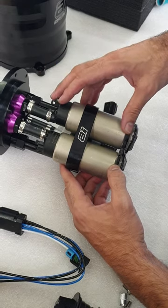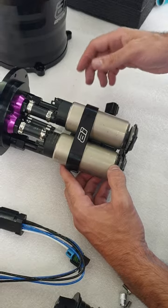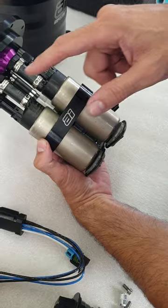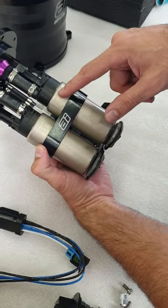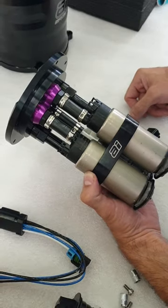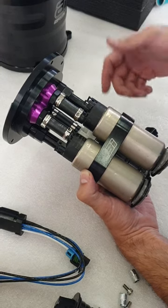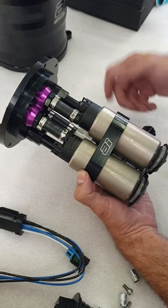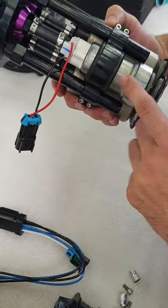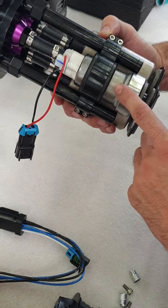In this application we opted for a hybrid setup, and this is our go-to combination for high horsepower supercharged V8s. Here we have two Bosch BR540s as the primary pumps. There are no check valves in a Bosch BR540, so these will run full-time. As a side note, the SPR 1500 will actually have an inbuilt check valve system for any application that requires pumps to be staged that don't have built-in check valves.